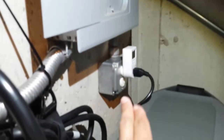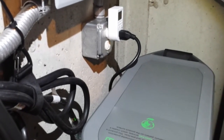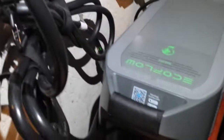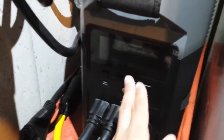Now I'm going to show you what the particular issue is. Before I power on the unit, I'm going to turn on this outlet here, which will allow grid power to come through to charge this, because it's at about 74% charge. It's not even charging. Normally, if the unit is off and you plug it into a power source, the unit is supposed to turn on automatically on its own — at least that's what it's always done for me. So I'm going to go ahead and flip this down, and as you see, it doesn't even power on.